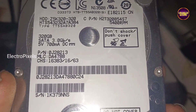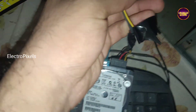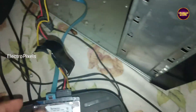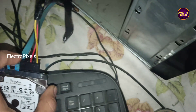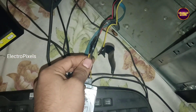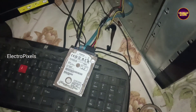Since the laptop hard disk drive works on 5 volt input VCC, but the desktop hard disk drive works on 12 volt supply. The desktop SATA power cable comes with both 12 volt and 5 volt. Here the yellow colored wire represents 12 volts, the red wire is 5 volt, and the black wire is ground.